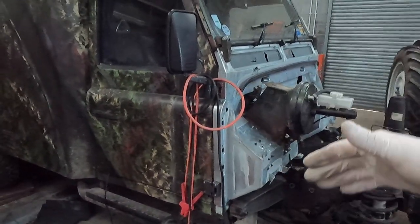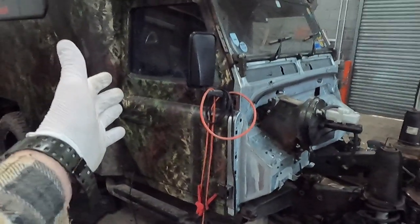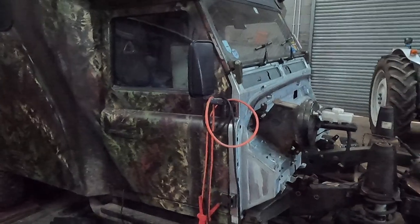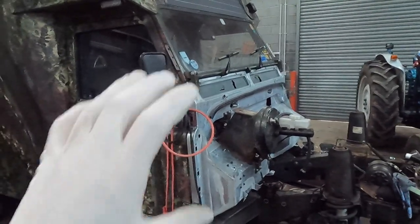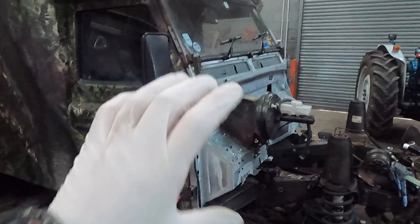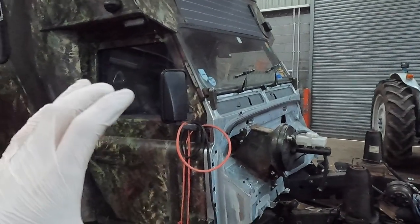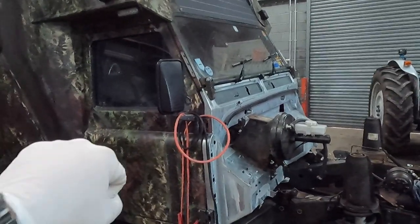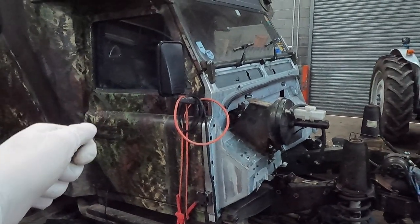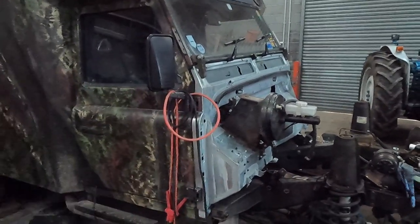We put a chain block on, ratcheted it, moved it in a touch, put the bolts in — job's good. What we did — and I don't know whether other people are doing this — is every bolt was put in but not tightened, so you could still adjust everything until the windscreen met nicely and all the seals were good. Then we closed all the doors, made sure they were all nice, then nipped up all the bolts. If one door was a little bit too far forward or back, we'd loosen a couple of nuts, adjust it, and tighten it all back up. The tolerance on these is huge.